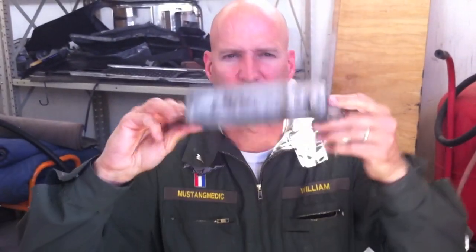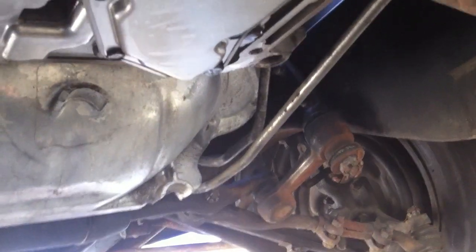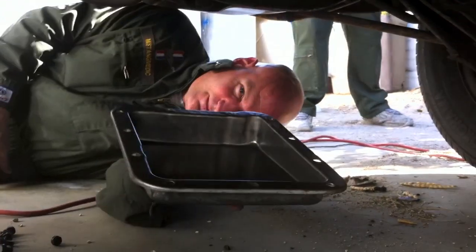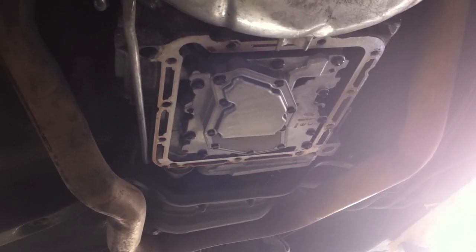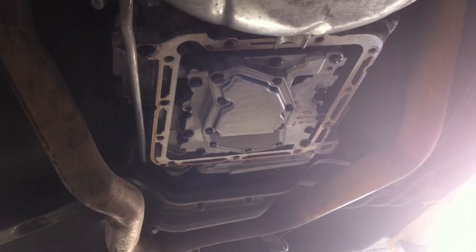Just looking and inspecting, making sure everything's good — and it looks good, nice and flat. Now Nick is going to do his magic — he'll get the gasket in there and the filter on. There are two different bolts: all the other ones are small, and then on the very corner there's one big one, the 7/16s. Here's the pan all flattened out. New filter in, new gasket going on, and it's got the bolts.